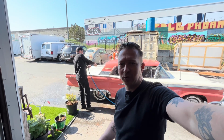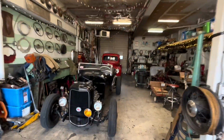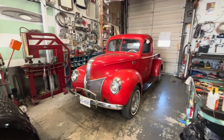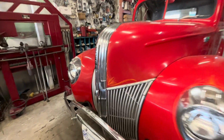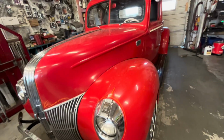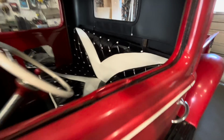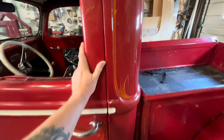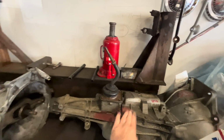The next video, you guys want to know what the next video is? Check this out. This is John Broman's 41 Ford pickup. This truck was painted in 1964, pinstriped in 1982. It is a super cool survivor 60s hot rod truck. And we are taking the 3-speed out, and we're going to be replacing it with probably this one, a T5 5-speed transmission. We're putting the T5 behind the flathead. We're converting the original Banjo rear end to open drive.